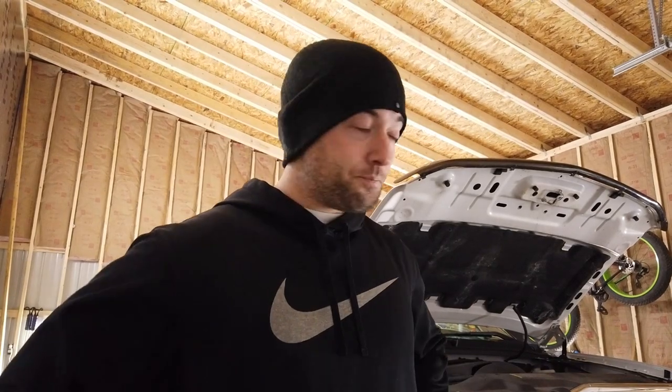I need to do an oil change — that's no big deal. I did put Seafoam in this just a little. I went and drove around a little bit, didn't have it in there that long. I wanted it to clean the inside of the engine. You're supposed to put an ounce per quart of oil, so this takes six quarts — I put six ounces of Seafoam in it. Hannah drove it around a little bit just trying to clean the internals. I'll probably do it again on the next oil change just because this thing's getting up there in mileage — I've got almost 140,000 miles on it. It's a good truck, it's been really good to me. Now I better go knock on wood because it's probably going to break down.